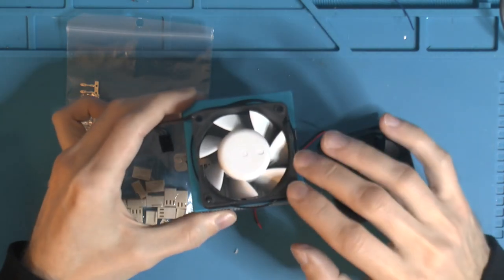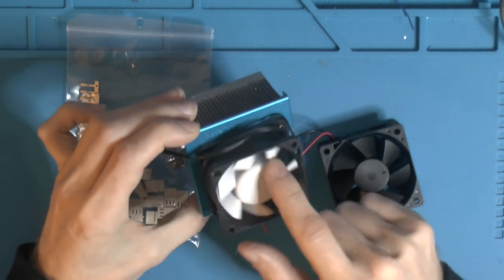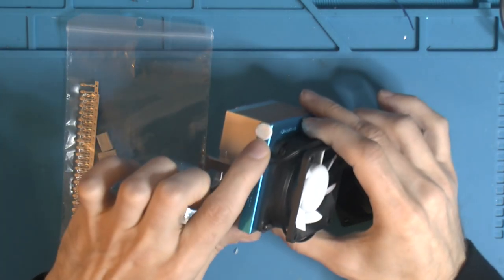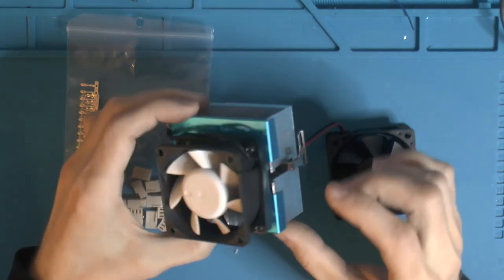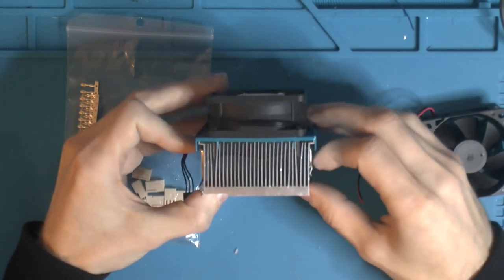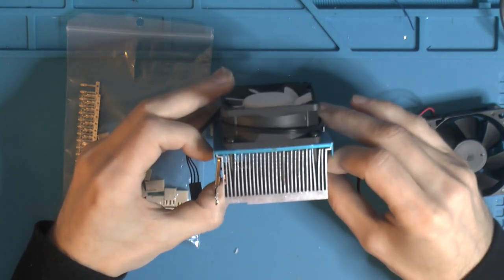Originally this has a 3000RPM fan, but I'm using a 2500RPM one that has exactly the same airflow as the original 3000 — it's a newer Arctic fan. This plate is on the wrong way and I'll fix that later. This piece is to make sure you don't short out the PCI card next to it. The whole point of using liquid metal and everything is to cool the die more, so it would be kind of pointless using a small crap cooler. This is about the biggest that could fit.